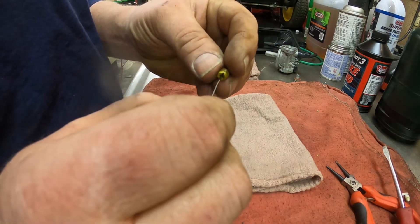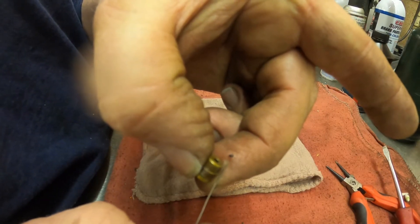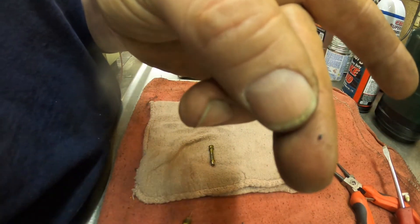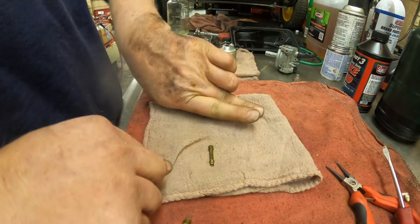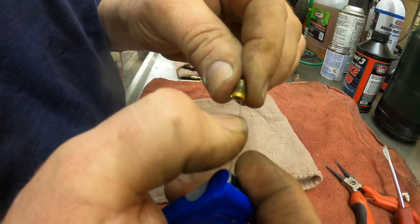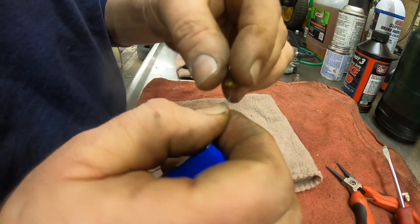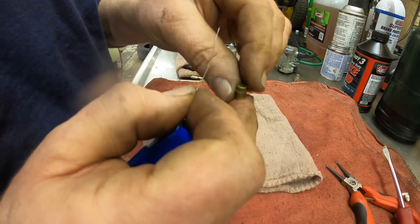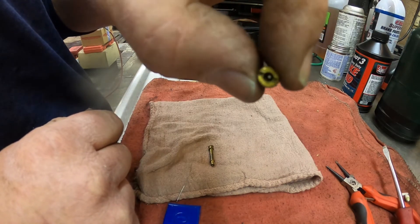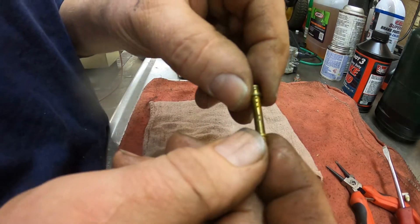I have not done the emulsion tube and jet yet — they've been soaking in gum cutter. I'll pour the gum cutter out into an old rag and pour those parts out. For this jet here — let's take the smallest tip cleaner up through it — and there it is, did you see it? That is the piece of dirt that just pushed out of this jet, causing this machine not to run. The tip cleaner has a built-in file so I'll just go ahead and file that around and get it clean. Now you can probably see light shining through that jet.